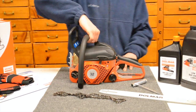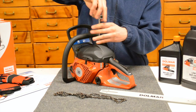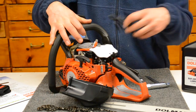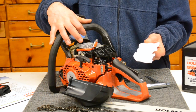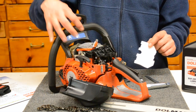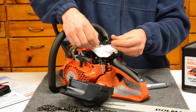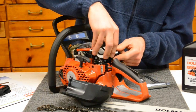Let's go ahead and tear into the air filter cover on this guy. There's the inside right there. This has got a felt filter which you can re-clean — regular soap and water works great. Any type of degreaser works really nice, but you don't want to use anything with ammonia in it when you go to clean it, as ammonia tends to eat away at this material. There's also quick access to your spark plug there so you can replace it. This is a dry filter, so you would not run any type of oil on that. Air filter maintenance is a breeze — it's not that hard.